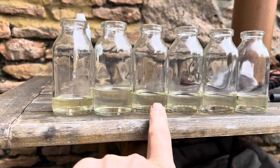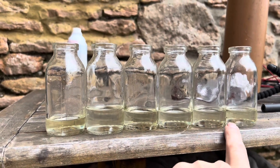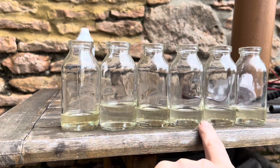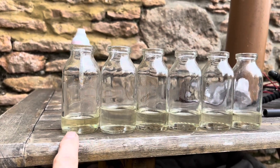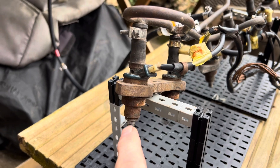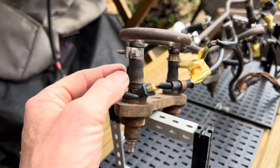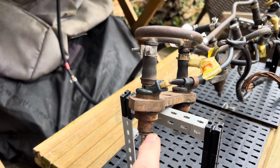Now we've got the other three injectors plugged in for five seconds. When you send these off to a professional injector cleaning place, they will run a constant stream of cleaning fluid through here for considerably longer. They'll put the injectors into an ultrasonic bath, back-flushing the filters, put new filters in, clean all the rust off, and hopefully paint them as well.